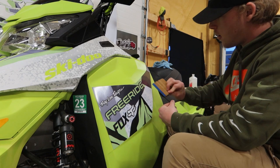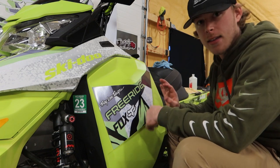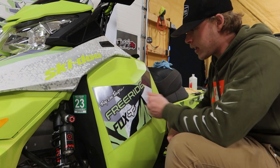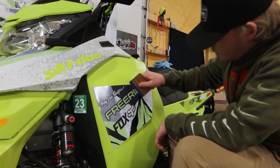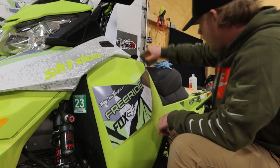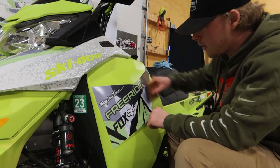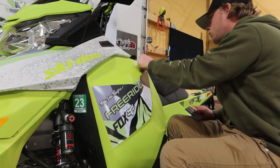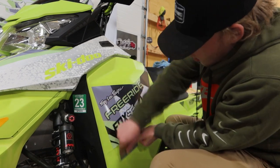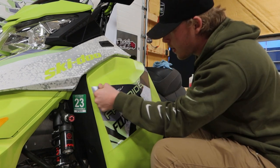Make sure you got a clean felt piece on your squeegee. If you do scratch it, not a big deal because this laminate is a self-healing laminate — if you get little micro scratches, all you do is take a heat gun to it and you're good to go. We're going to squeegee this on there with nice firm strokes, 50% overlap on your squeegee strokes. This does have a little curve to it — not a big deal with this material because it is so sticky. Go around your edges and make sure those are down. That's the biggest part that's going to fail on sled wraps, so you want to make sure you go around those real well.